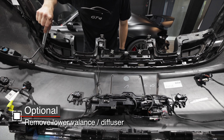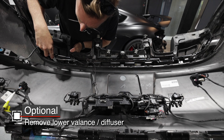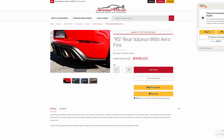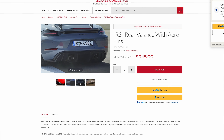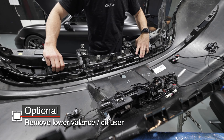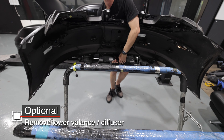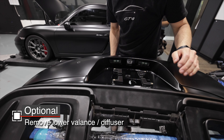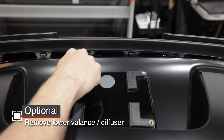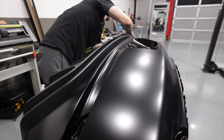The lower valence or diffuser is held on by 12 really stiff plastic clips — that's why a plastic trim tool doesn't quite cut it; you want a metal one. Work those plastic clips off and the diffuser will come off. You can replace it with a carbon fiber one, or an RS one with those little wings. You don't have to buy the full kit from Suncoast — you can just buy the wings from your Porsche dealer or wholesaler. The wings are about $180 each and you'll need some screws. To properly do it, you'll need to screw into your diffuser, though a lot of people get away with just some 3M tape. I'll have part numbers for the wings and screws in the description.